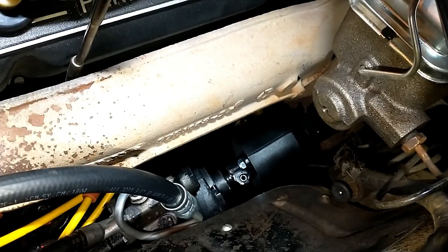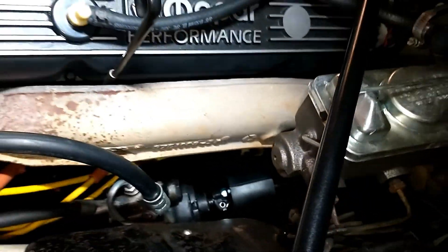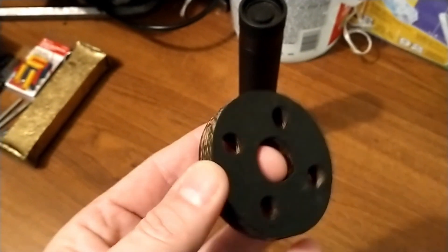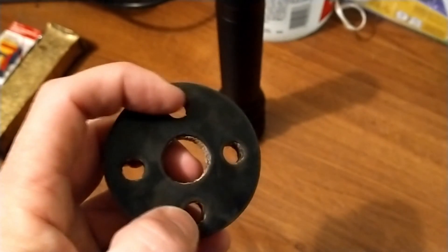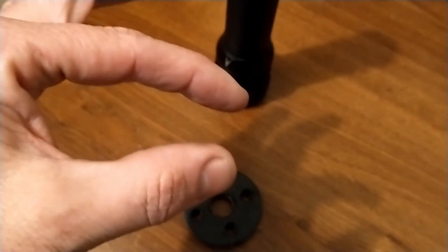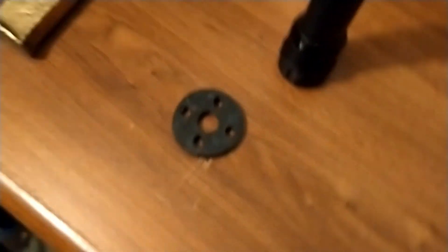Now just got to put it back in, tap the roll pin back in place once we get it back in, and then wire everything back up. I put the steering wheel back through the firewall — you'll probably need some help holding it up so you can get it right back on the spline, then tap the pin in again. Some of you may be asking why I couldn't just use the over-the-counter Dorman part — the holes were too close together and caused the screws to go in at an angle. The bolts for the VW Beetle lined up perfectly, so I just used those instead.